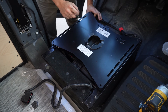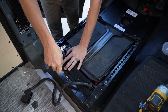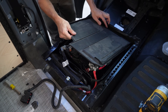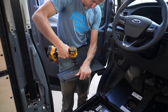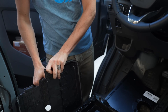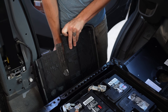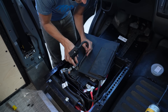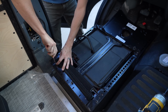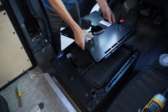We made a mark in the plastic cover in the middle of the swivel, then took a nut driver and removed the bar across the length of the seat pedestal. We removed the plastic battery cover, used a step bit to drill a hole in the battery cover on the mark we made previously, and then used a box knife to cut a slit from the hole to the back of the cover. We pulled the wire through the slit into the new hole, then replaced the metal bar and hardware, replaced the swivel, and pulled the wiring harness through.